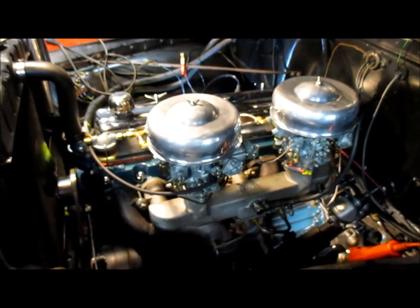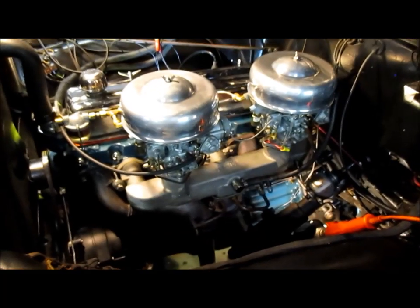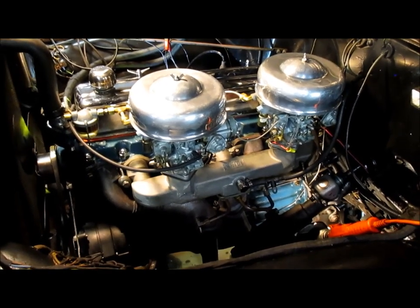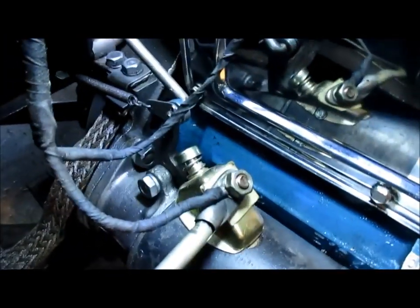Some other things I've noticed since I've been putting some miles on it, the oil stains that I'm seeing on my cardboard, I don't think are necessarily coming from my main seal now. Primarily because if you look down there at the block, you can see it's real shiny in that corner. And we go over in this end, and it's real shiny down in that corner behind the starter. Now, what that's telling me is, how am I getting oil leaking there? So I reach behind the head here, and I'm coming up with oil.